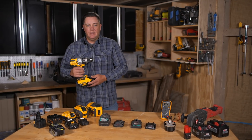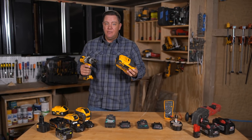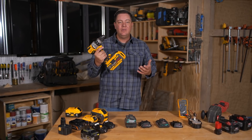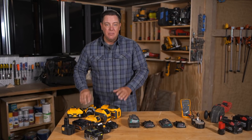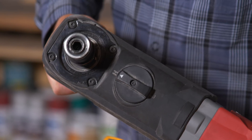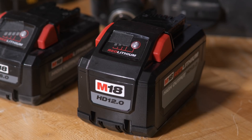As an example, this cordless drill has an eight amp hour battery in it and will run for a really long time, giving us plenty of power. But they make a bigger version really meant for larger tools. It does fit and you can use it, but I can't imagine holding this all day trying to drill holes — it's way too heavy, just overkill. Batteries like this are really meant for bigger tools like table saws, circular saws, and other large cordless things. If we put a small battery in a large tool, yes it'll turn, but it really won't be able to do anything — it needs the amp hours to actually operate. Let's load these batteries in, grab a piece of wood, and show you what we mean.